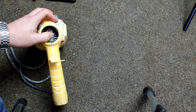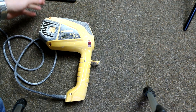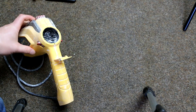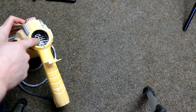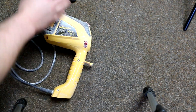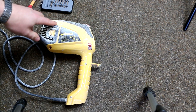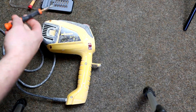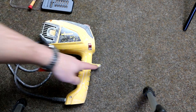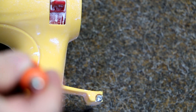I decided to open it up and see what's going inside, but I couldn't find many videos on the internet about how to do this. This is about how to open this one — let's try and hope to fix it. What you will need: some bolts are really deep here so you won't be able to get in with a regular screwdriver. It needs Torx 15 for all these bolts — this one is Torx 10 but they come inside with a little hole, so you need Torx 15.